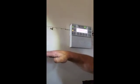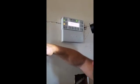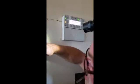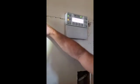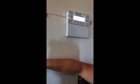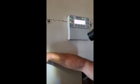We are in what they call a float zone. So our float zone is 100%, 0%. Here's 50%. We're like 60%. So our charging doesn't go up over 60, but it doesn't come down below, I believe it's 48. So we're staying in that float zone between 48 or 46 to 60. So your battery level is here at 50%, so we don't overcharge up to 100, and we don't deplete its source down to 0. So they're always maintaining somewhere between 40 and 60%, which increases the longevity and lifespan of your battery.